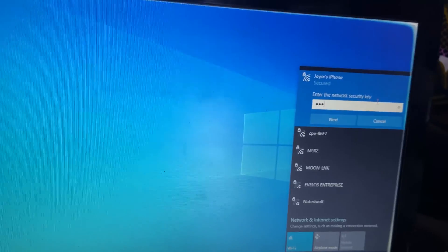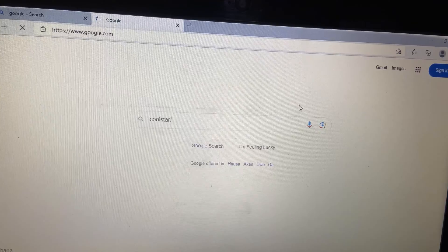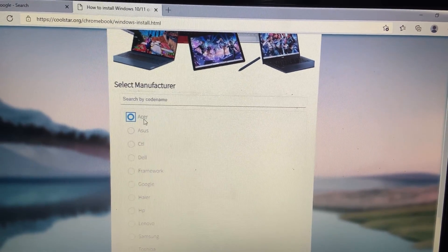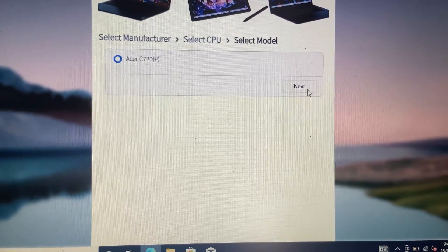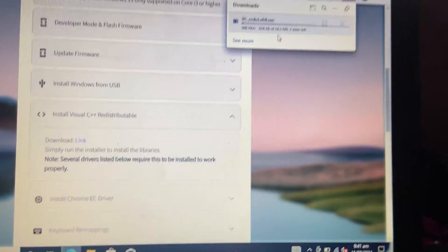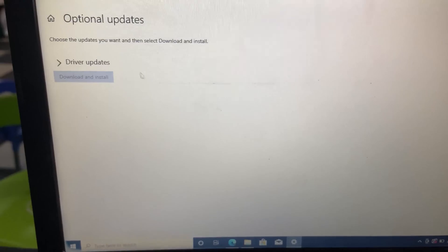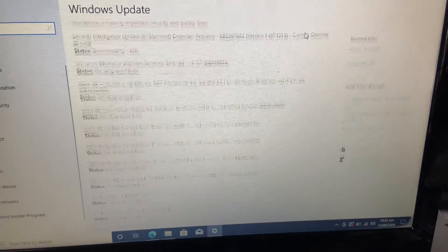When the Windows installation is done, we will install the correct drivers. Connect to Wi-Fi and browse to coolstar.org — the same website we used to check compatibility. Select your Chromebook model and download and install all available drivers listed for it. When you click the arrow beside each step, there is a link to download the drivers, so download what is available. After installing the drivers, go to Settings, click on Update & Security, and check for Windows Updates. This will also fix some additional drivers not found on coolstar.org.